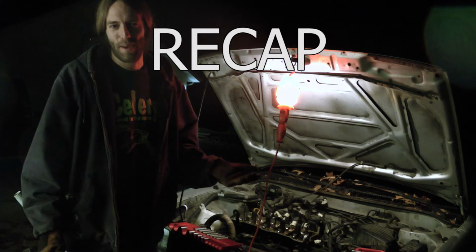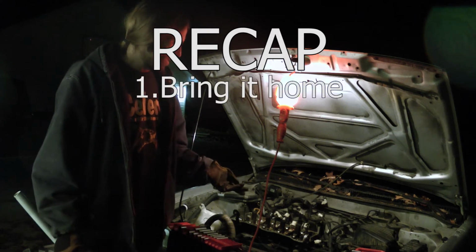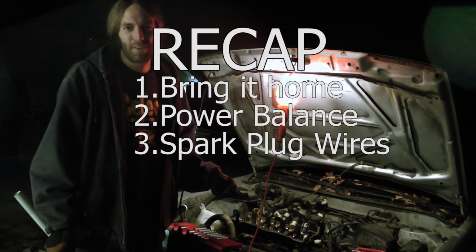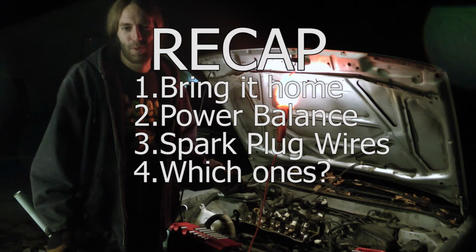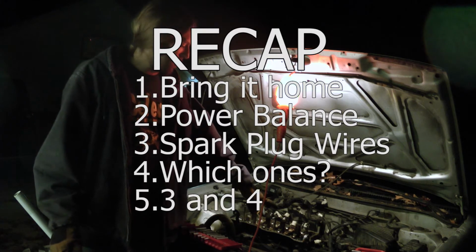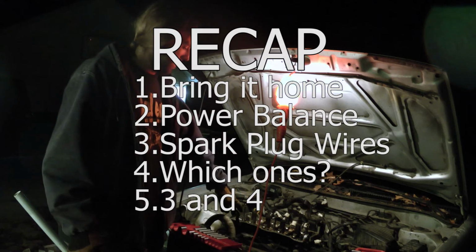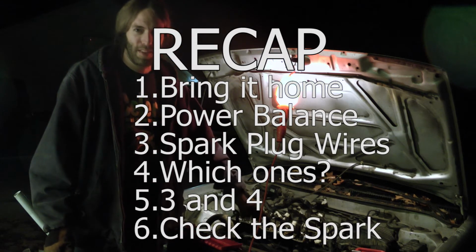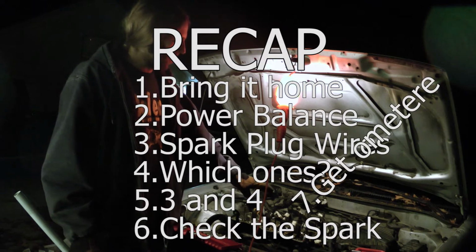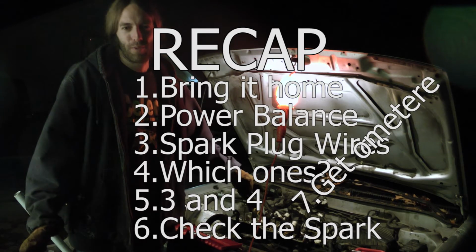It lost just about all of the power, so I brought it home, started doing the power balance test, pulling spark plug wires off of it to see which ones were making it drop out, and it was 3 and 4 weren't doing anything. They had no power. So I checked the spark, and they had spark. Got the ohm meter out. All the injectors were pretty much 14 ohms.